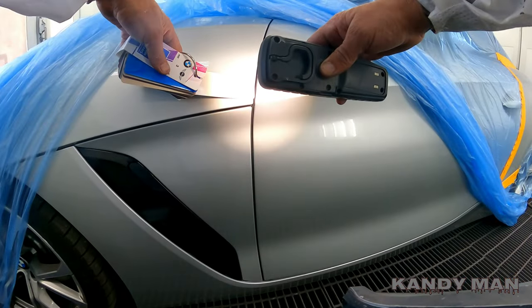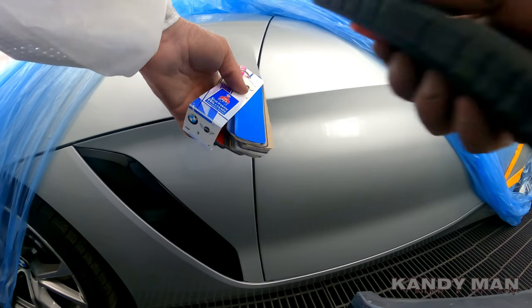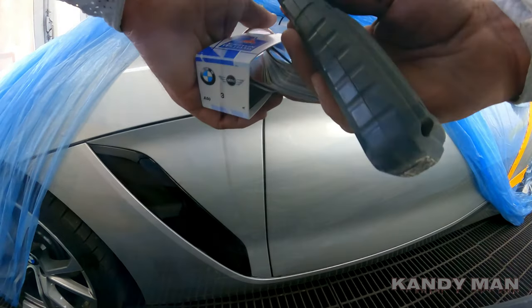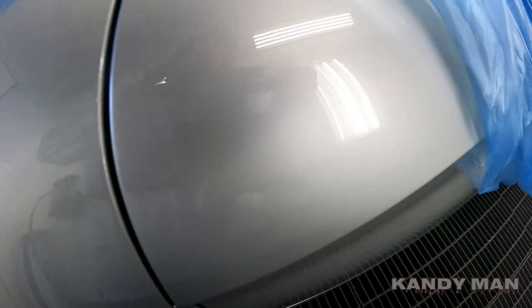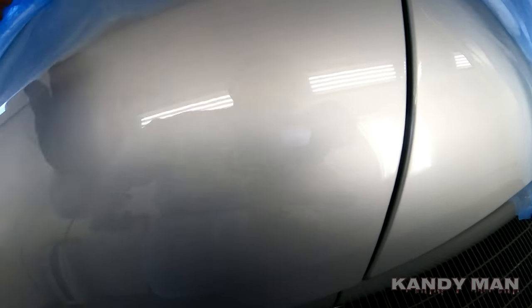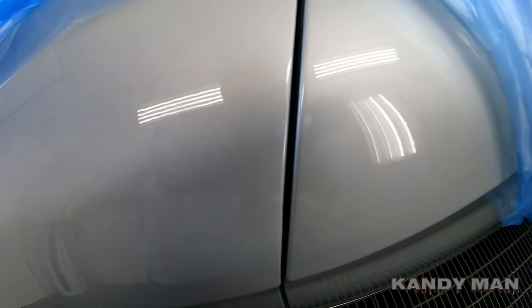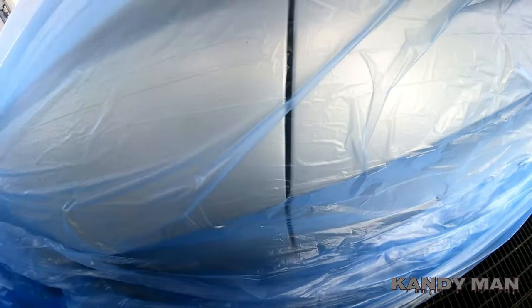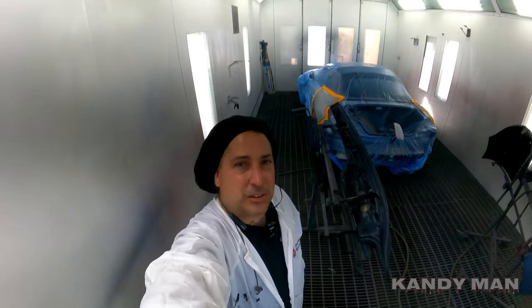So this chip doesn't look too good — they do have a lighter variant so you guys can see it's definitely a little dark. I'm going to see what the lighter is. This car has got a really pretty fine metallic on it — I like those fine metallics, they look nice. I'll see what's going to be mixed into this one, probably some real fine silver. I'm going to spray the lighter variant, spray a card, check it, and see how it looks.